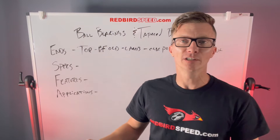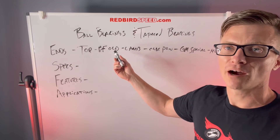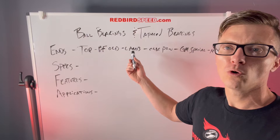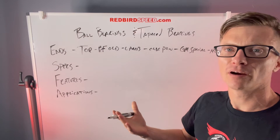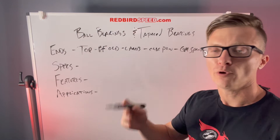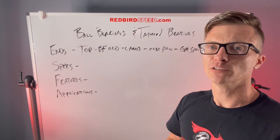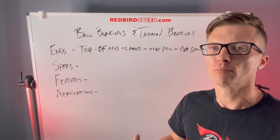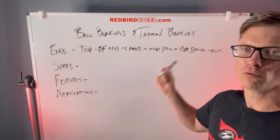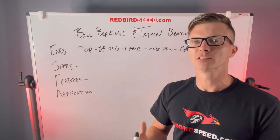There are a few applications: the big Ford new style Torino, the big Ford old style, like a Lamb Symmetrical, Olds Pontiac, and a GM Special — that's your Camaro, Chevelle, Nova — where you open up the whole inner backing plate, the bearing comes through, and you put a retainer plate on the outside. It's like a nine-inch style setup but with your original factory drum brakes. There are also several hybrids with Mustangs where they've incorporated the same style of setup.